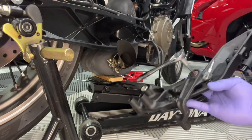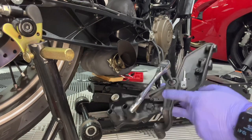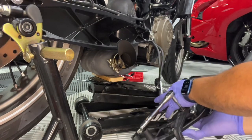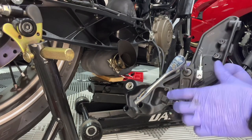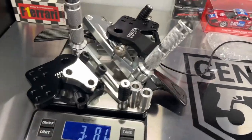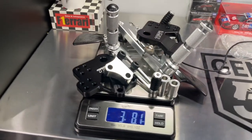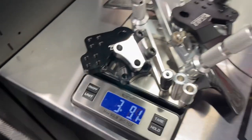In order to remove the rod itself, I can't get the pin fully out because the heel guard is in the way. I need to remove this arm — it's a little quarter-inch ratchet, about a 6mm — loosen the arm and then I can remove the rod and put it back in the master cylinder. The instructions don't cover this step since on an RC390 it's totally different and you can access everything with the set still on the bike.